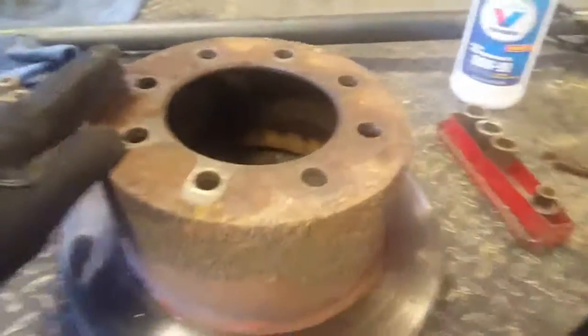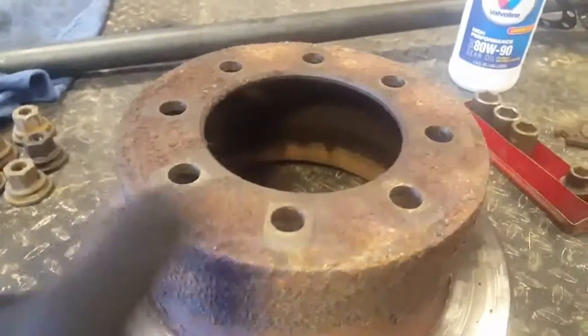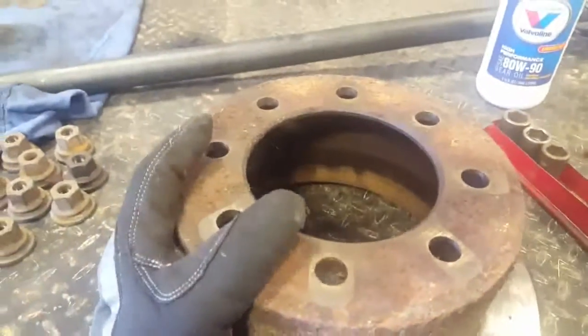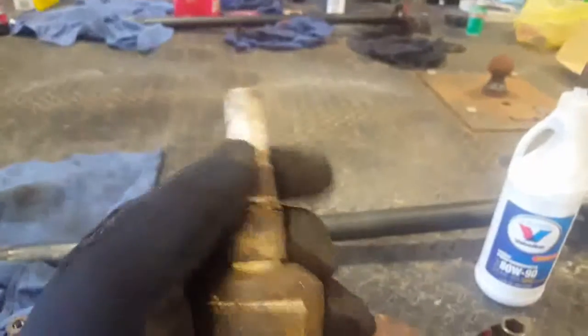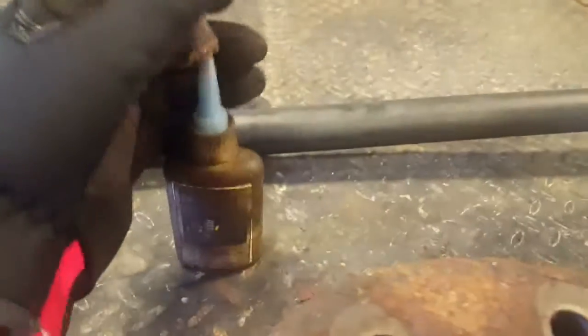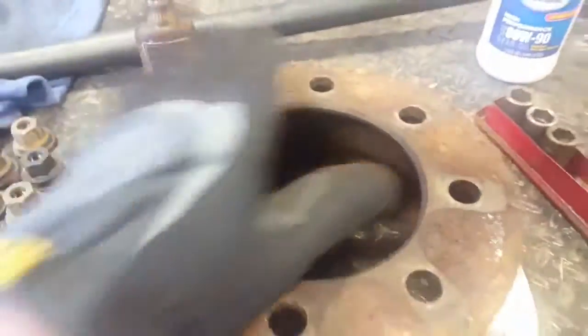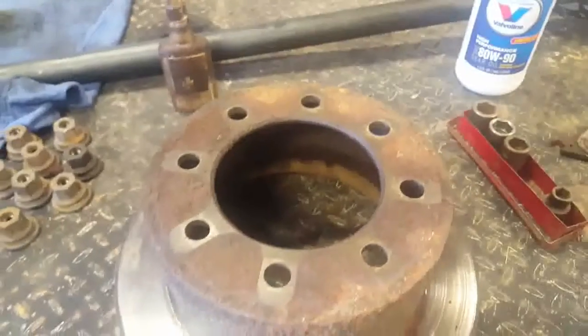Okay. Now your hub is going to bolt to the new rotor flange here. It's got 8 bolts. They're 1/2 inch grade 8. I torqued them down to 95 foot-pounds, and I also ran blue Loctite on them. This is Cat brand Loctite. Loctite, Cat, same difference. As long as you use blue, I don't believe I'd want to use red on it. These are imperative. These are Loctited and torqued.